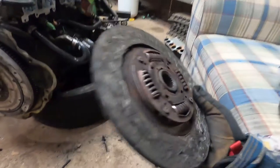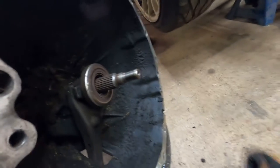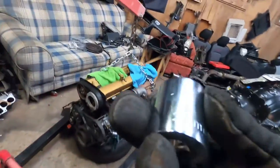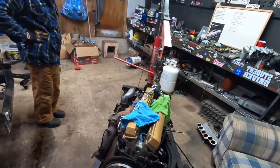I'm not sure if I'm going to need a new clutch - I probably should. This one's looking pretty ratty and pretty thin. The flywheel could probably use a resurfacing. The trans is filthy on the inside but the bearing seems real nice. All we have left to do is remove the six bolts on the flywheel. I also picked up a 27mm socket for the crank bolt - we'll hold it with the breaker bar and break the flywheel bolts loose. Take the flywheel off and then it should mount to the engine stand and I can return the engine hoist.